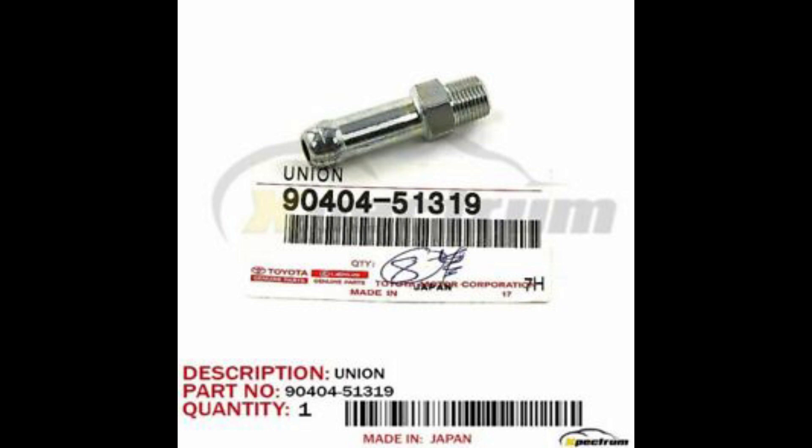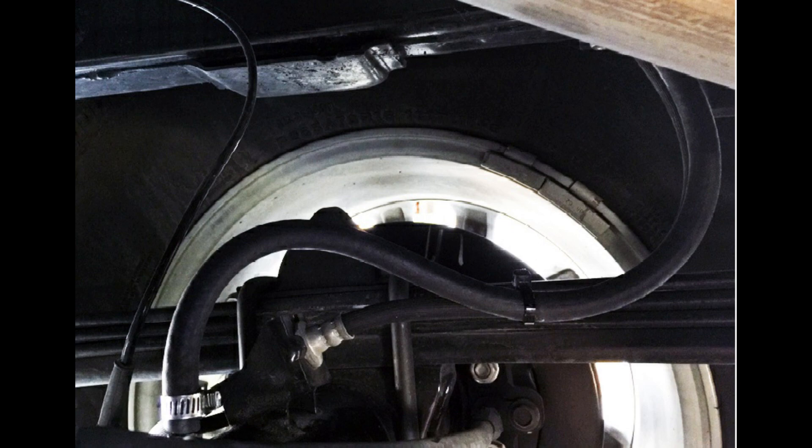When you're done with that, take your fuel injection hose and route it along where the brake line goes, so that when the axle moves up and down you have the ability to follow that movement without getting kinked or overly stretched. The bottle itself can pretty much go anywhere up around the rear area of the truck. Some people have actually removed the taillight — there is a cavity back there — and if you had a smaller filter or didn't use this bottle idea, there's enough room to run the vent all the way up there. If your vehicle ever encounters water reaching that level, you've got much bigger problems than a little water getting into your axle vent — you're probably flooding your cab and may have hydro-locked your engine.